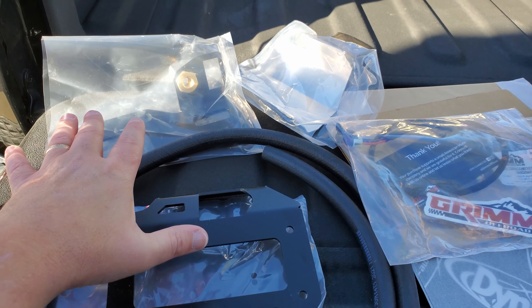We got the air chuck on here. The universal chuck from Home Depot is about double the length of the ARB one, so I've got two tests: make sure the fender closes, and first let's see if it builds up pressure to the safety cutoff of 150 PSI. It reached it — there we go. Good test. I'm checking for any marks to see if the chuck touched the liner — it doesn't appear to have touched, so it looks like we have enough space, probably just barely. I'll take it. Now I can use a universal fitting chuck and not be reliant on anything ARB-specific.